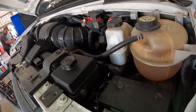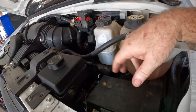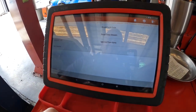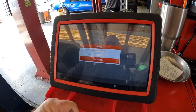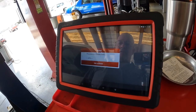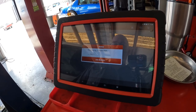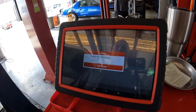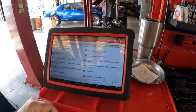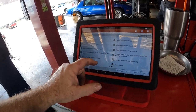All right, I got this monstrosity to act up. Lost voltage on that fuse, put my test relay in, now I've got it running. It's been about 10 minutes. I'm going to go in here and look at the fuel pressure while we have it, just for kicks — want to make sure she's good to go. Might as well, since everyone up front told me they probably had a bad fuel pump. I'm just glad that on this one they didn't already order the fuel pump and pre-sell it. Luckily they at least let me look at it first.